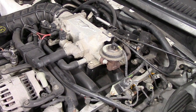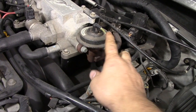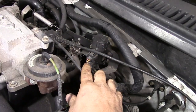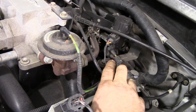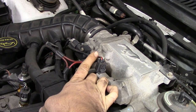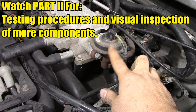Okay, now let's get on to actually showing you how each different component looks like on the car. This guy right here — as some of you may know — is the EGR valve, and this is the vacuum line that controls the valve or the diaphragm that's inside here. If you can follow this vacuum line, it goes to your EGR solenoid, which is this guy here — it has the electrical connector that goes to your ECU. This EGR solenoid has two vacuum lines going to it. The green one is the one that goes to the EGR valve, and the red one goes all the way around here to your throttle body — that's where the vacuum source is. It uses the vacuum from the throttle body, regulates it, and then operates the diaphragm inside your EGR valve.